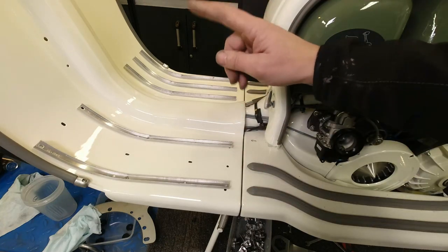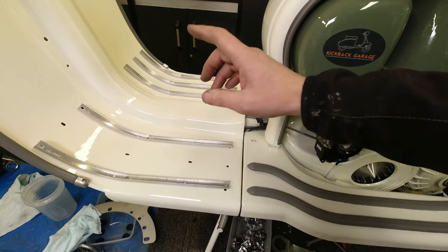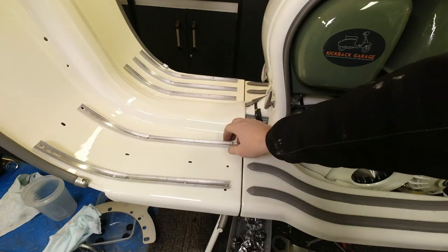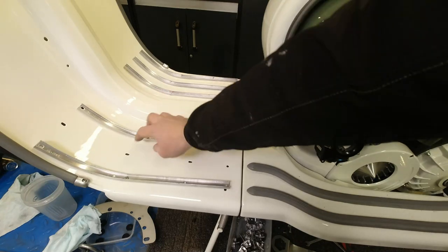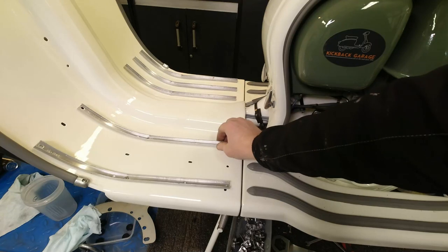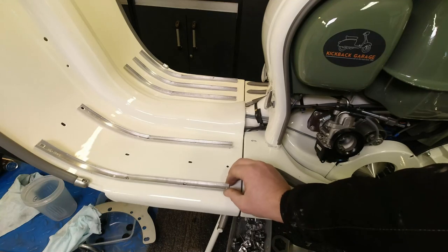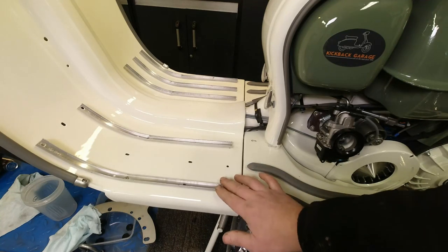What I'm going to do now is remove this side at least — I've got it nicely lined up. I hate it when there's a bigger gap on one side than the other, but there is some leeway. So what I can do now is tighten down the two bolts on the top there in front of the horn cast to the frame. I'll fit my runners — they obviously have to fit the outside and the inside, because they're the two on a Series 2 — they are the ones that fit to your strut with the screws. And I didn't fancy taking them off, so these have been sitting pretty here. I have to be really careful — don't scratch it on camera.